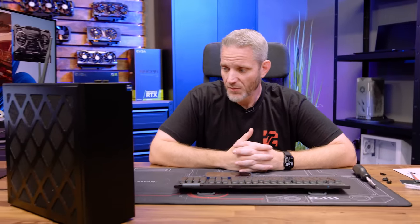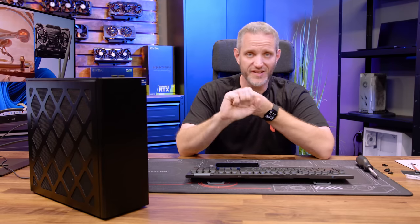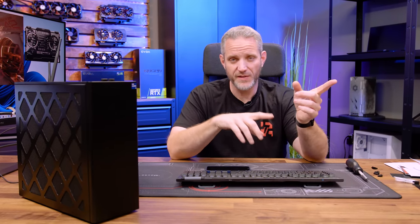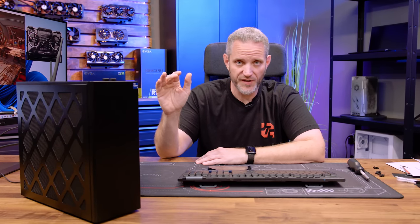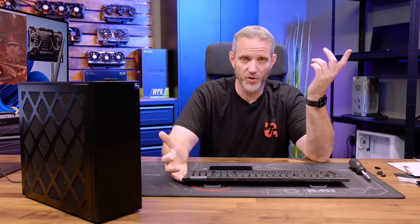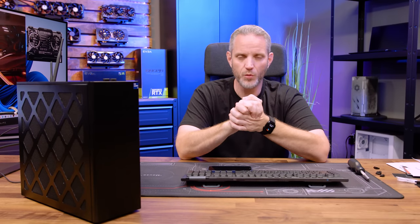The GPU is not throttling — it's holding 1800 MHz, which is where it boosts to out of the box, making this one of the smallest, most powerful computers you can buy today. It is scalable: the NUC 13 Extreme comes with either a 13900K, 13700K, or 13600K. The power supply is the same for all because it has to support up to a 3080 Ti. 3090s and 4090s won't fit — and the 4090 wouldn't even boot if you tried. But there is a 300-watt 12VHPWR plug, which hints at forward compatibility for mid-range cards in this release cycle. It has both standard 8-pin PCIe 6+2 connectors as well as the 12V high-power adapter with one sense pin enabled for 300 watts.